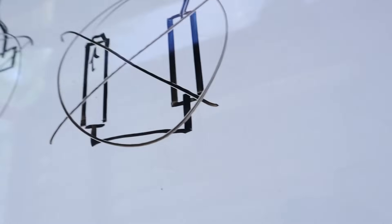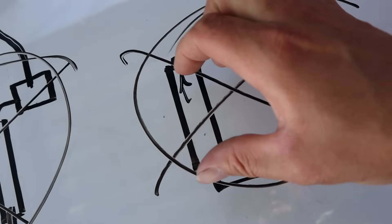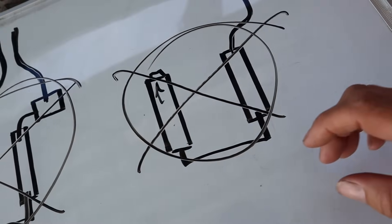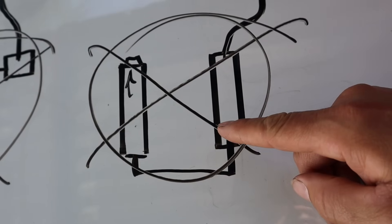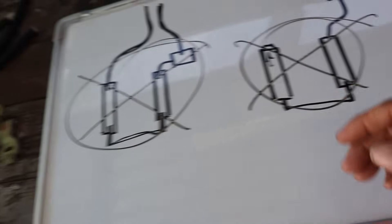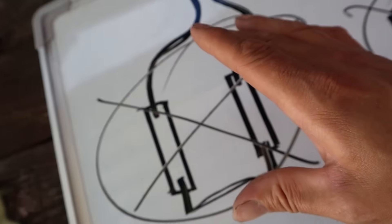It's kind of crazy because this is how just about everybody runs their fuel system. I did a lot of research and what I found makes 100% sense. If you run it in the first orientation you can run into the problem of cavitating air — air bubbles inside your fuel system — causing a lean condition. On top of that, these four fuel injectors could see a higher fuel pressure than the other four. Moving to the second system, you don't have to worry about air cavitation, but you still have potential lean issues.